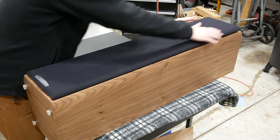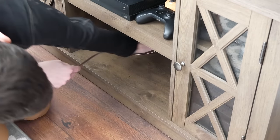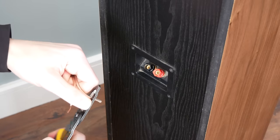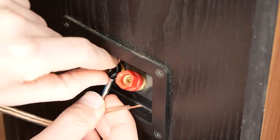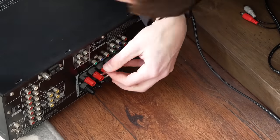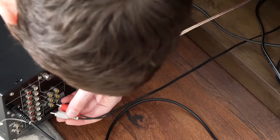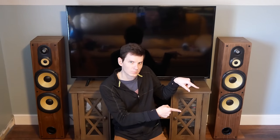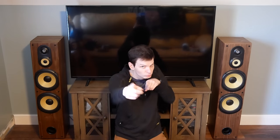I don't know about you guys, but I think I like it better without the grill. To install the speakers, I fed some speaker wire through the back of my TV stand to the speaker location, pulled the wires apart, stripped the insulation off the ends, and twisted the exposed wire strands together. Eventually I'll get some banana plugs for these, but for now I inserted the wires into their respective terminals and tightened them down. Once all the wires were run, I plugged everything into the back of the old receiver I'm using to power the speakers, slid it into place, and it only seems appropriate to let the speakers bring this one home. And we're done restoring the speakers! If you enjoyed the video, be sure to like and comment, and consider subscribing. All tools and materials used are linked in the video description, and if you want to see more projects like this one, check out my other videos. Until next time, go build yourself and restore some speakers.